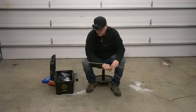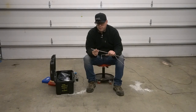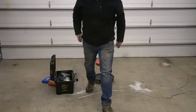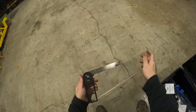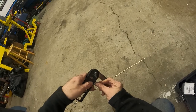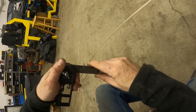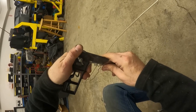First off, we're not putting our fittings on just yet and we're not flaring until we're done. I'm going to leave myself quite a lot of line length on the end here. It looks like my very first bend is going to be a 90. The last tool you're going to want is just an angle finder like this — harbor freight, you don't have to spend a lot. You just come in here and check the angle — oh look, it's 90. Actually it's a lot more than 90 — yeah, it's pretty much 90.